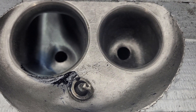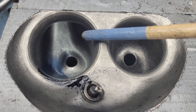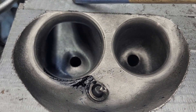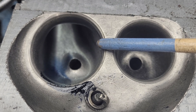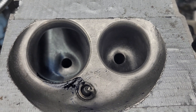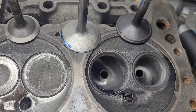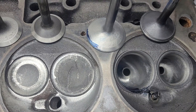I definitely want to discuss his valve job. I am so tempted to take the valve job he has here and change it for a steeper angle to see what happens — if I change it for a steeper angle I can put a little bit bigger throat in, and that might really pick it up. Remember I've got to get all my testing done on this chunk, because I can't afford to screw these up — it was hard enough to have Tim donate me a set of heads.